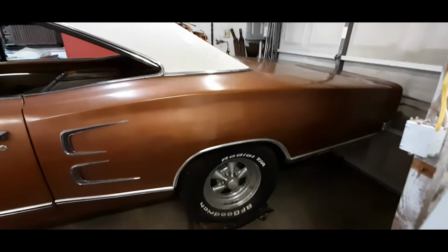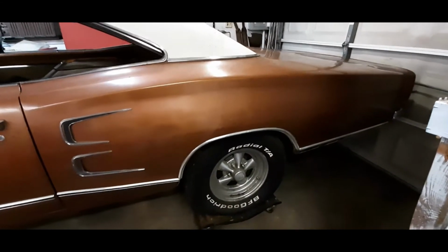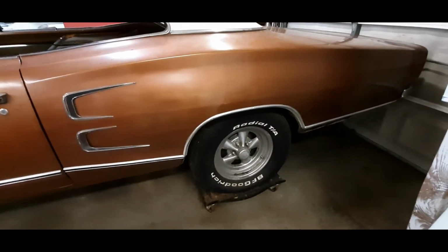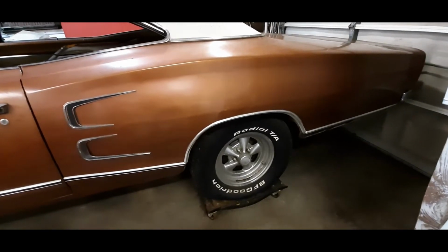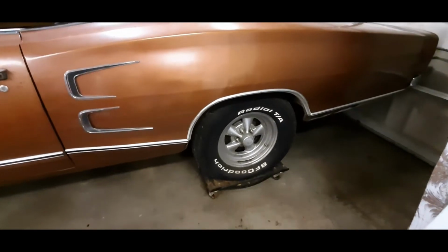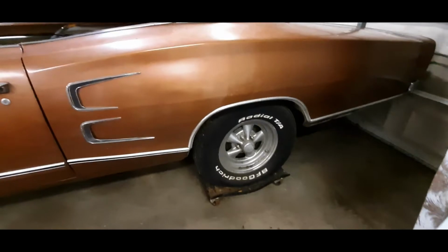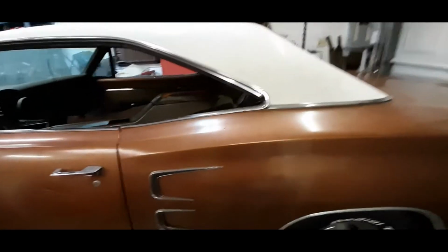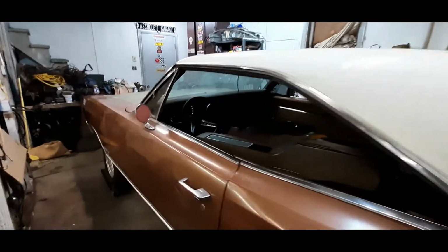It's got a Dana rear out of a '66-'67 B-body Mopar. I bought it up in Lancaster, Pennsylvania, or York, Pennsylvania, probably 20 years ago. I think I paid $650 for it. It had 538s in it, racing studs, all that. Took all that out, put in a 410, rebuilt the Sure Grip and all. Only got a couple thousand miles on it.